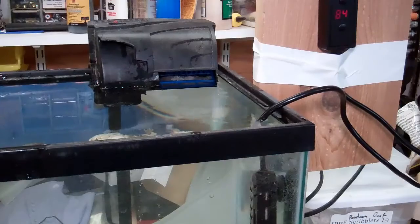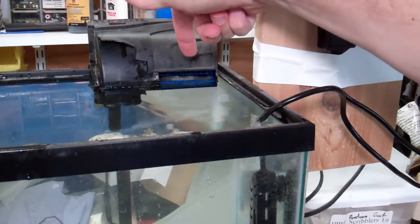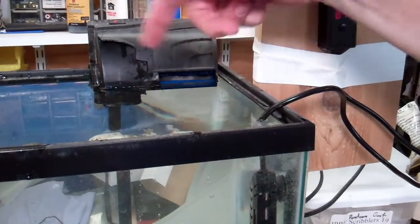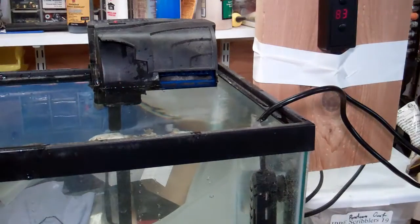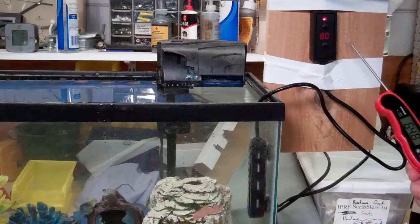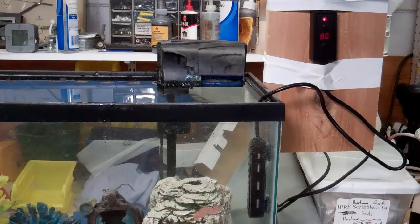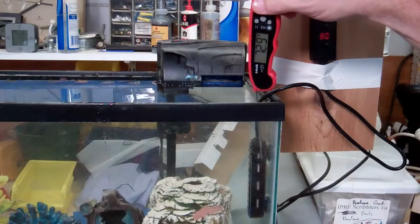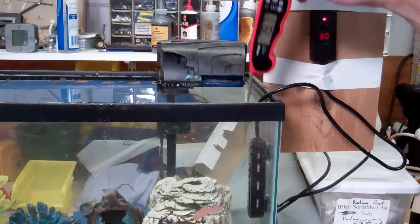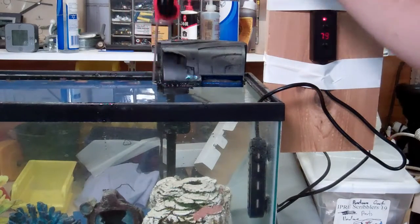Okay, I've installed and turned on this aquarium pump, which is pulling water out and then dropping it out here, and it's essentially pushing a flow of water past this aquarium heater. Okay, set point is set to 95 degrees. The thermometer thinks it's 80 degrees in there because it's measuring very close to the thermometer down here. So you know its temperature sensing is right there, which is about 80. The actual water right now is 73.6 Fahrenheit.